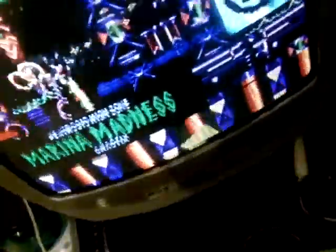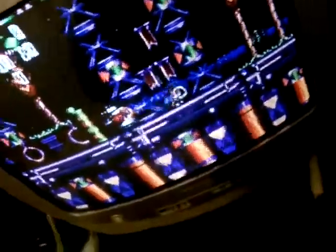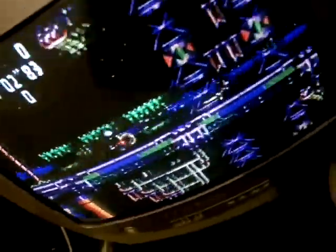There we go. Mega Drive 1 connector on the bottom, Mega Drive 2 connector on the top. So yes, unfortunately, I think it's that wire that's causing that buzzing, because when I connect the 32X to the Mega Drive 2, there's no sound problems at all and it's fine. So I'm guessing it's that adapter wire that's causing it.